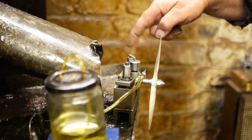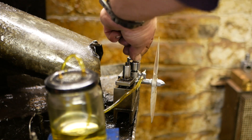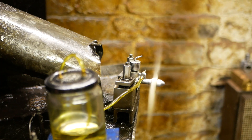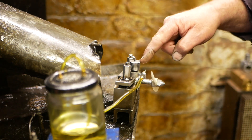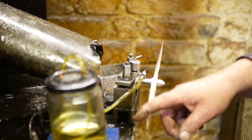I've backed the compression off to be able to stop the engine. Now to start the engine once it's been run and is warm: if you turn the compression back to its original setting, draw fuel in just once. Remember where it came from — turn it back to there, suck in just once.